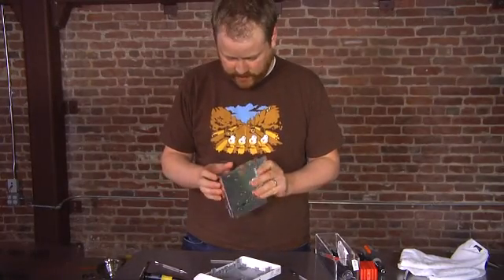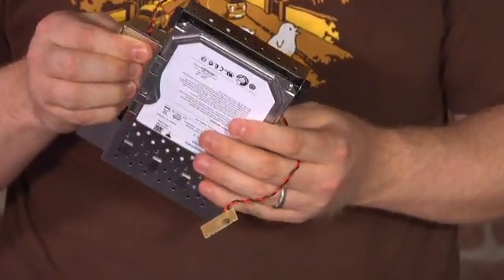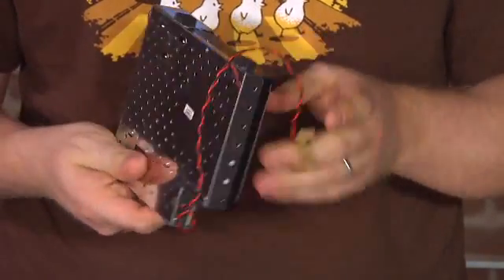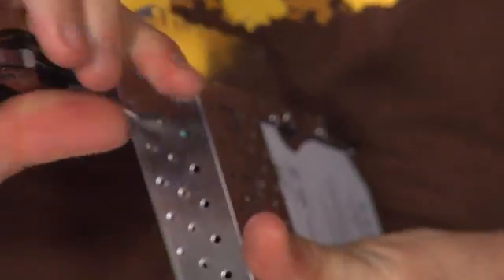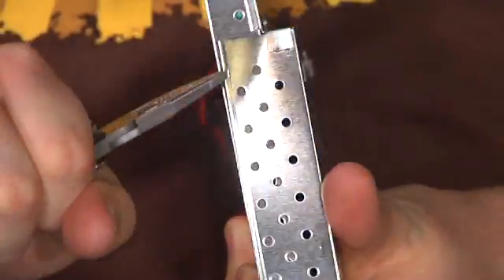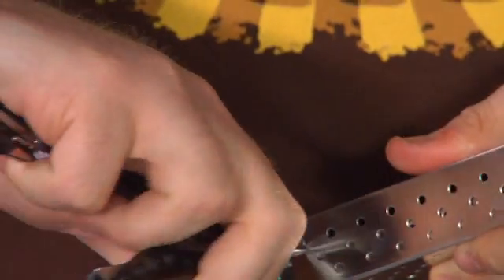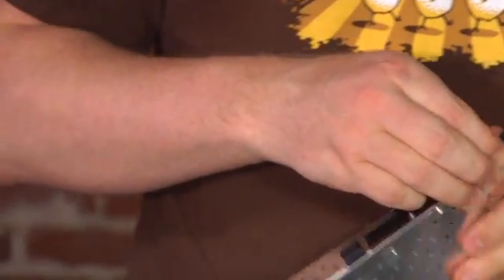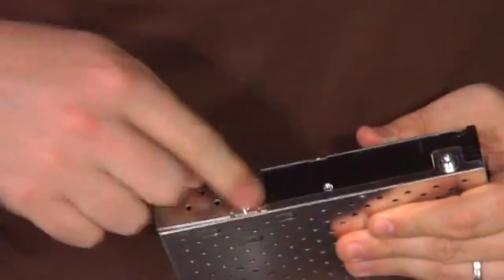This is one of those places you can get really badly cut if you're not paying attention because this stuff is all pretty sharp. There's a metal seam right here — I don't know if you can see it. I'm going to use pliers on it because, again, this is a piece of hardware that we don't care if it survives or not. You know what? I bet the stickers conceal something. Yes, they do. These big rubber feet are covering screws that look like they hold the whole assembly together. So let's bust out the screwdriver.